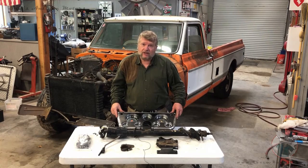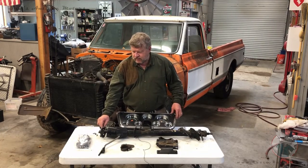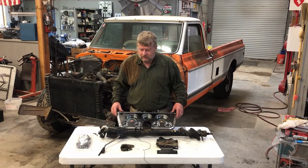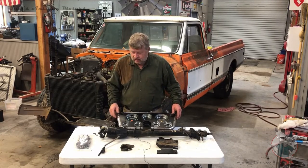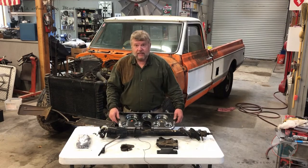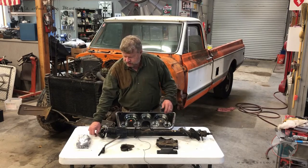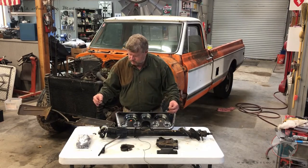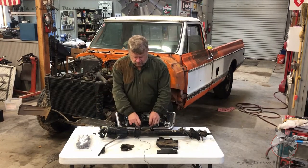When the last video left off, I was trying to get this steering column out and started taking apart the turn signal wiring indicator, which was starting to look pretty tricky with a bunch of springs. So I took some photographs of it. I then quickly learned it'd be best to take the dash out to access some of the wiring. To get the dash out is pretty simple — there are six little chrome one-inch pan head screws that go into the bezel.